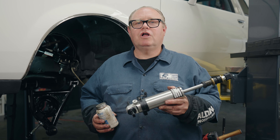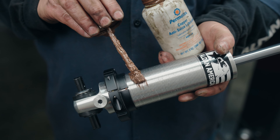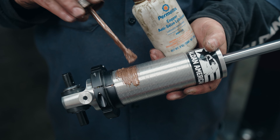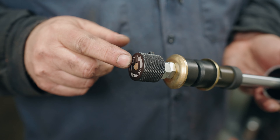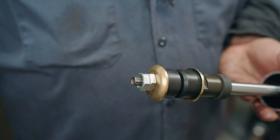I'm getting ready to install our RCX double adjustable shock. One of the things I must do first is apply a little copper-based anti-seize above the spring seat. When we adjust the spring seat for ride height, the anti-seize will get underneath so the spring seat does not gall against the aluminum shock body. When disassembling the rebound knob, do not undo the set screws — just unscrew and remove the knob.